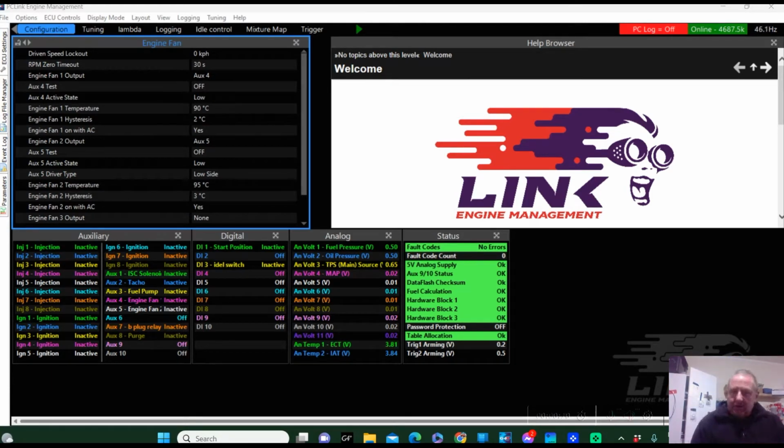I'm doing some testing on a loom here on the bench, a 1UZ, as I do 1UZ looms, and I thought I'd do a little video on setting up the CAN lambdas. I'm going to be putting 2 CAN lambdas onto this particular job. Also, just a note for the owner of this loom, I am going to supply a trigger wheel, a 36-2.